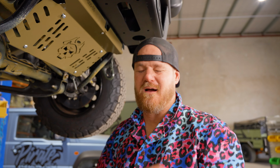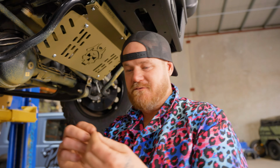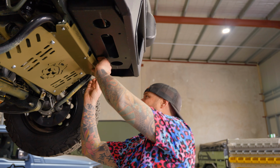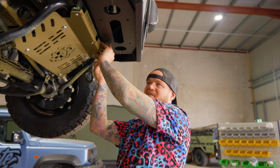Now, if you have a bull bar, what you're gonna need is an M6 bolt. So I've just grabbed an M6 socket head cap screw. Or is it a cap screw? Anyways, whatever. M6 socket cap screw, it's like 16 mil long. It's perfect for it, right size. Bunnings sell heaps of these. You can put a hex bolt in there if you want, but just an M6 by 12 or 16 mil. 16 is probably better. And you'd be away.